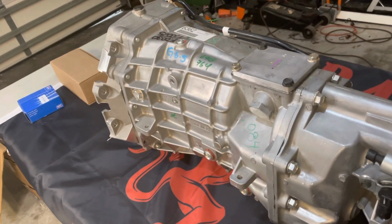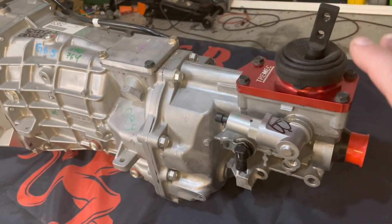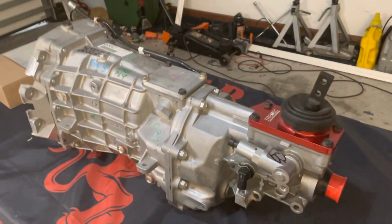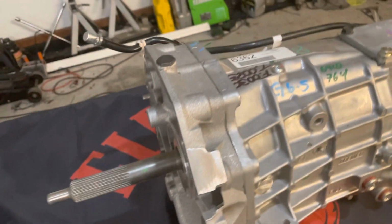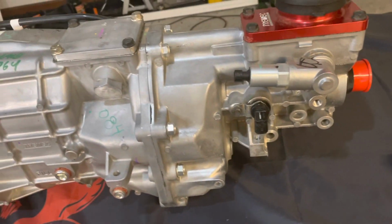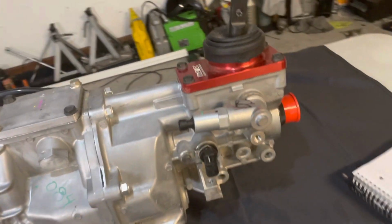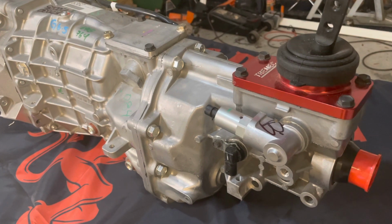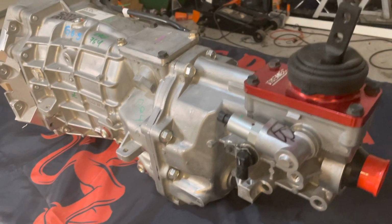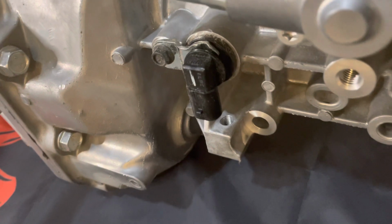The Magnum, one thing that's different is the Magnum did have a mechanical speedometer as well as electronic. Now, this Magnum F only has electronic, and it's probably because the Tremec boys, I'm sure they were just thinking about the 4th gen F bodies, which all of them LS1 cars are all VSS electronic speedometers, which is right here. And you know, us early 3rd gen guys, we've got the mechanical. I was hoping it'd have a mechanical, but it doesn't. So I still need to get the conversion box for that from Dakota Digital. So I think that's important to note, because the Magnum has both, and so I had to research that a little bit, right?